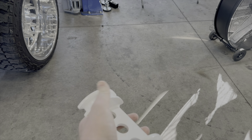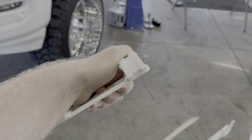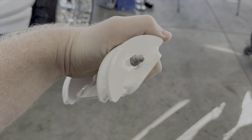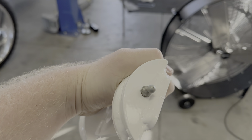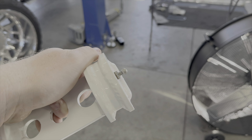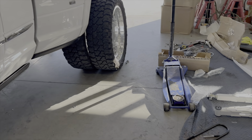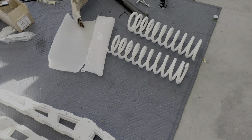For anyone that's got rear ride height sensors on the 3500 and they're doing a lift — this is a little trick we had for the top hats on the Striker stuff. We got a six-by-one drill and tap. We drilled and tapped, then screwed the ball stud into the side of the top hat. It's going to retain your factory sensor height location and everything's going to work how it should. All we have left is to get the traction bars on and we're going to get this thing finished up today.